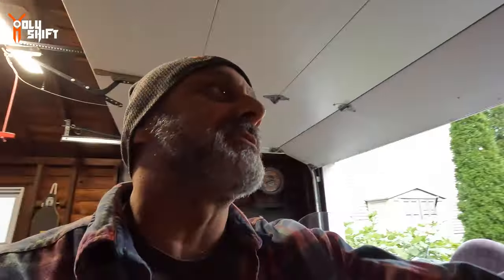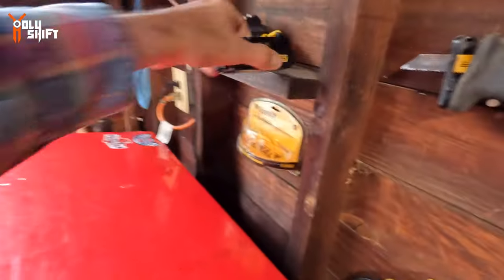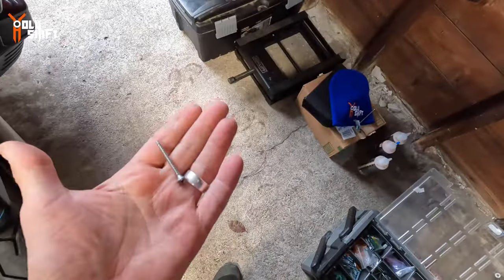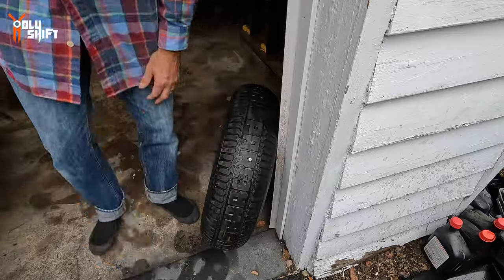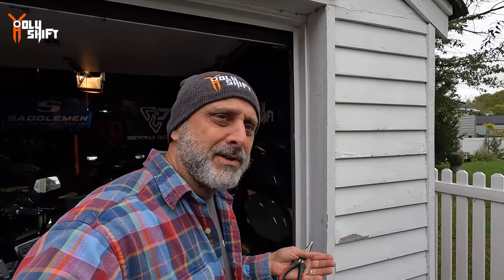Step one: let's simulate a flat tire. I have a set of pliers to rip out that screw — my kit doesn't have pliers, so I bring my own. Many times you have a screw or bolt inside and a very slow leak. That's actually a good case, because once you take that screw or bolt out, that's when the air comes out. You have to consider whether to continue with the screw still in until the nearest repair shop.